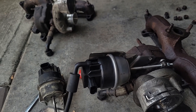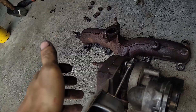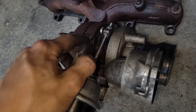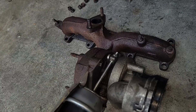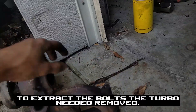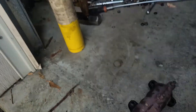With this replacement being so cheap, there's not much use converting one of these motors back to the ALH style. Going into this job, be aware it should only take one to two hours unless the bolts break on you. You really want to use a torch, maybe even some PB Blaster — let it sit overnight if you can. Nothing could save this turbo here though; the car had been off-road several times and had the oil line snap despite using a torch.